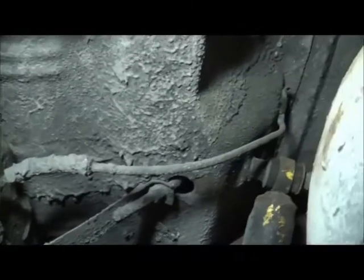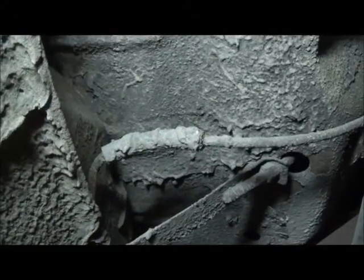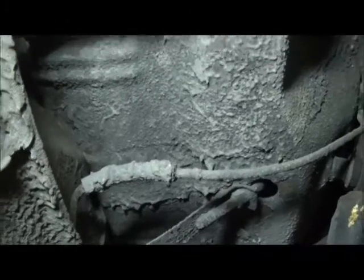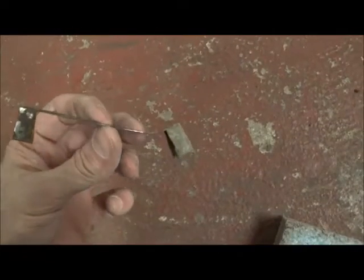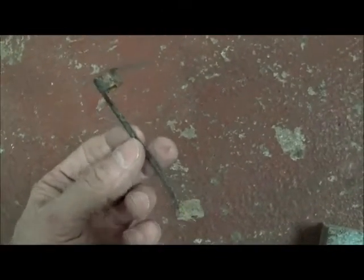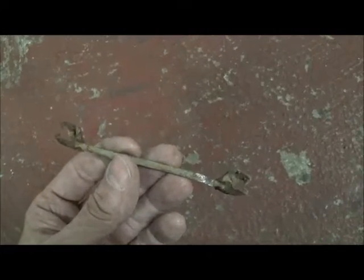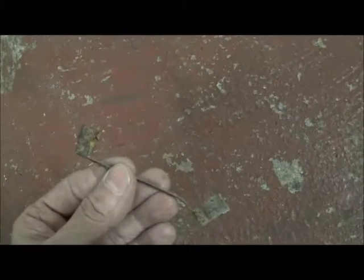This pipe that you're looking at is the vent, and that is the tank feed. We'll have to get the undercoating off of those rubber pieces, which are probably original. This is the ground strap that goes from the fuel sender to the fuel line. It's important that you reinstall this when you get to the reinstallation point, otherwise you don't have a ground for your gauge to work.